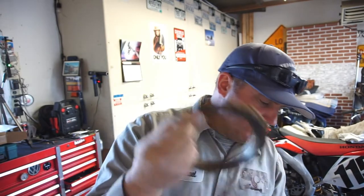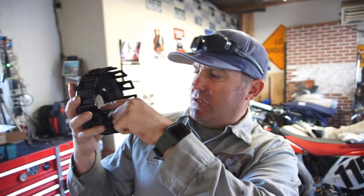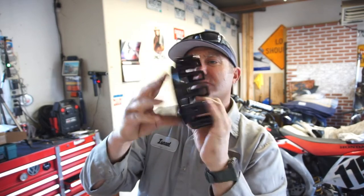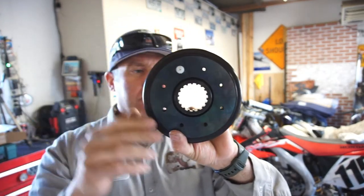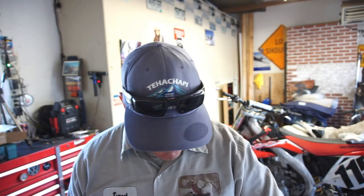Here are the fibers — 'HF' whatever that means. We'll soak those in oil before we assemble it, but it's not ready to be assembled because we still need a pressure plate. Good — it's got the teeth. The one they had on eBay didn't have this; it was just open, which looked like a KTM style. This one comes with a little nylon thing in there.